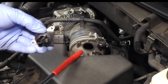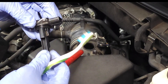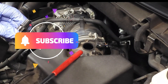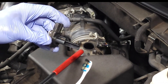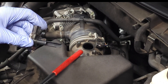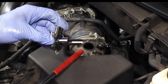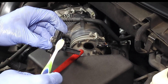You can see right in here there are two electrodes and there's one on the side — there's an electrical wire in there as well. Occasionally, if you pull off your air filter and it's extremely dirty, or maybe you had an aftermarket air filter where you actually add oil to it — and there are filters that you add oil to — sometimes you can add too much oil. If you add too much oil, that oil is going to blow by the filter and it's going to get caught on this mass airflow sensor.